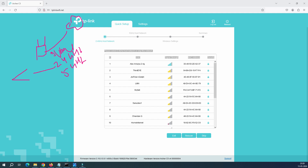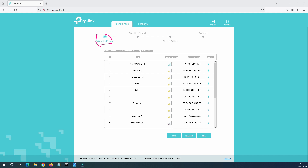The 2.4 GHz band gives you more range, meaning you can access the device from a longer distance. The 5 GHz band gives you less distance but much higher signal strength, meaning you get better speed. So: 5 GHz gives speed, 2.4 GHz gives distance. In the Quick Setup, the 2.4 GHz tab shows available networks with signal strength — you can select any.